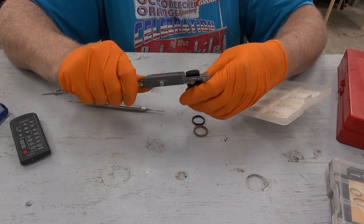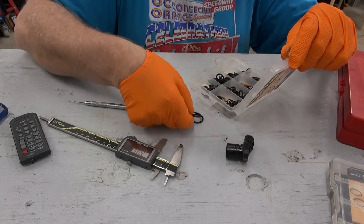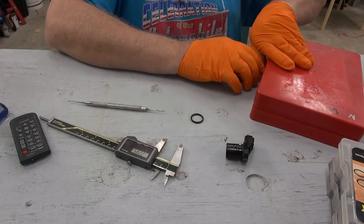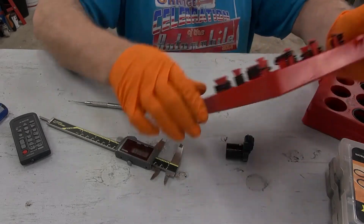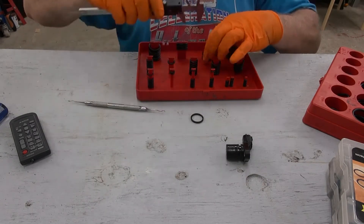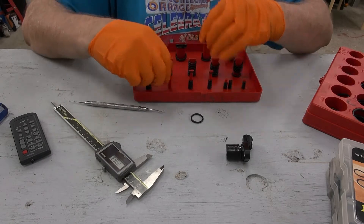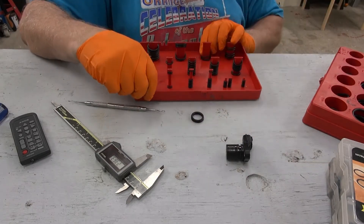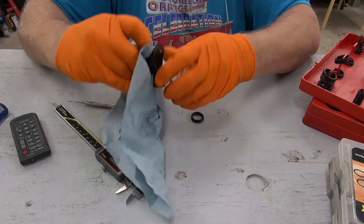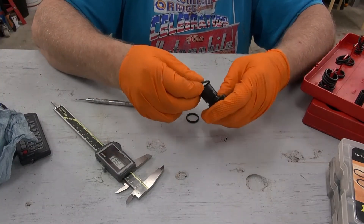This one's going into a 20 to 21.6 — too large, too small. I've got another package here. Sometimes you just have to go buy one. That one looks about a 22 — I might go with that one. No harm done; I'll put this o-ring in there, check it after running the engine, and if I still see leaks I know I need to do something else. I'm going to install this one.